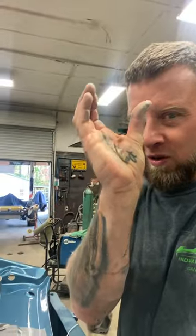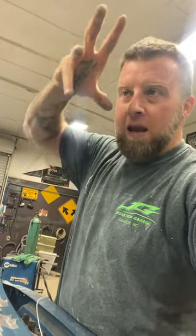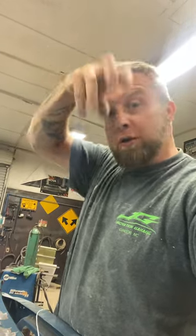It's gonna start doing like this right here. And as the tape is pulling up on it, as the string is pulling tight, it's gonna take all four of those loops and make a cradle or a basket or a noose, whatever you wanna call it, and it's gonna suck all that tape up into a wad in a knot, and then it's gonna go whoop, right down through the tunnel hole.